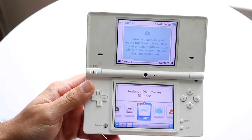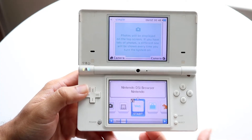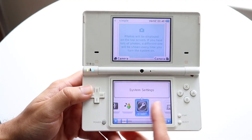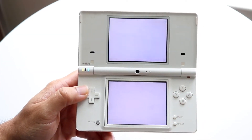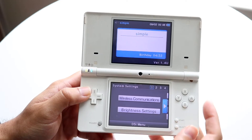There are a few things to keep in mind. One, these are older consoles, so they don't really support the latest Wi-Fi connections we have nowadays, like 5GHz Wi-Fi. Sometimes you'll have to connect to a 2.4GHz version of that Wi-Fi. So make sure you have a 2.4GHz network enabled, whether you have a Nintendo DS Lite or a DSi.